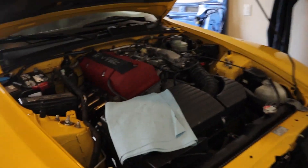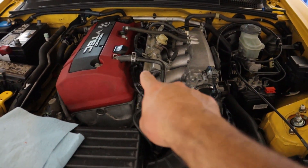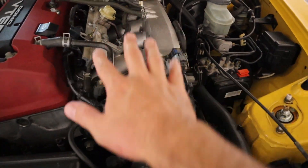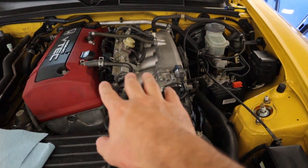There's a lot of things I want to look over. I put new injectors in with new seals and O-rings, so this has all been taken apart. I want to make sure when it's ready there are no leaks. I'm not going to start it right away. What I'll probably do is put the fuel pump fuse back in and just see if there are any fuel leaks at all — check the injectors, the fuel rail area, everywhere the fuel system has been touched.